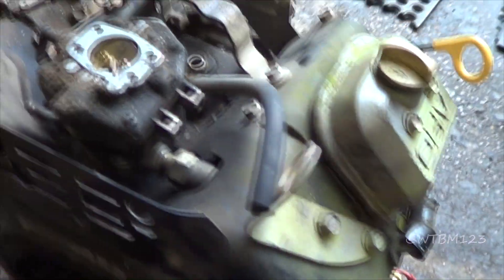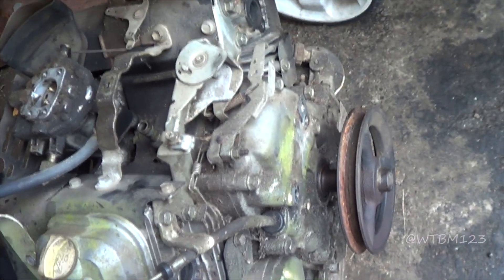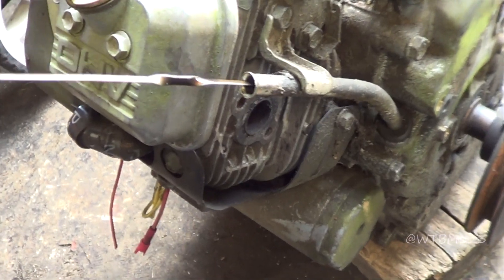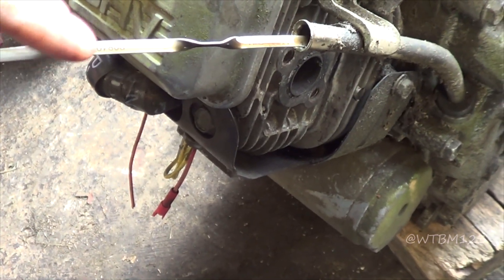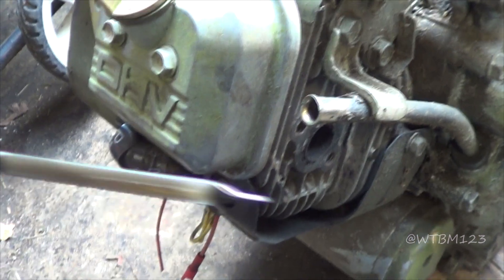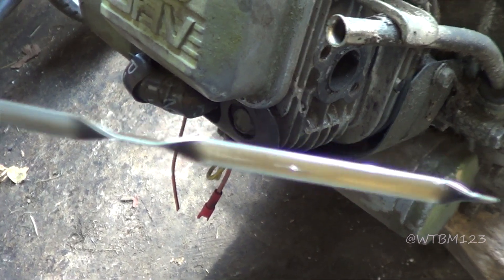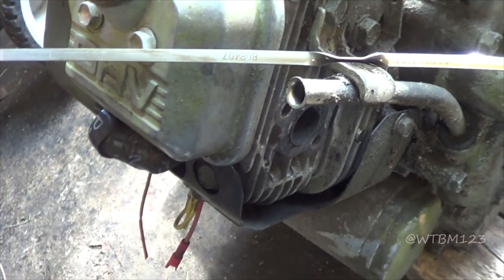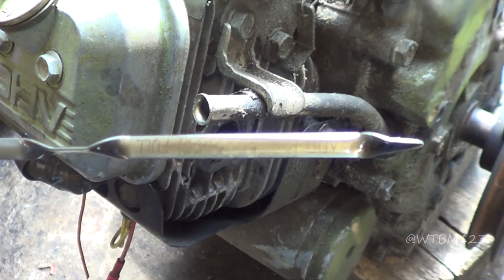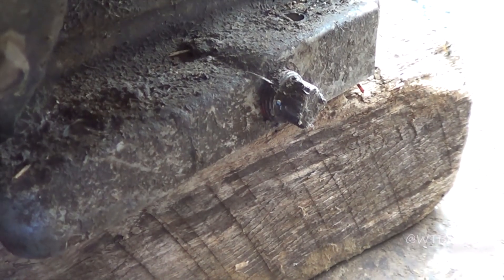Looks like it's been a little taped up on the plug wire there. The oil mark is all the way up to here — it's supposed to be down here. But it doesn't smell like fuel. It looks fairly clean. The first thing I thought was fuel, but I smell it and I cannot smell fuel. If it was that far up on the stick, way past the twist and all, you'd think you'd smell fuel if it was that diluted. I'm gonna let some out, and once it runs I'll change it anyhow.